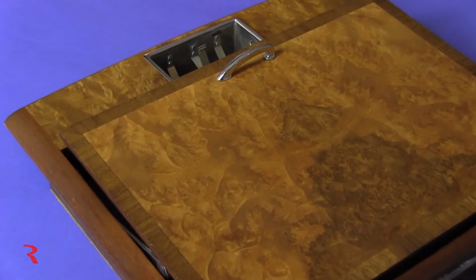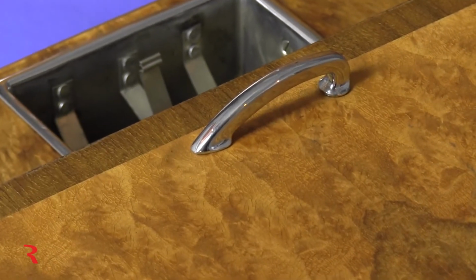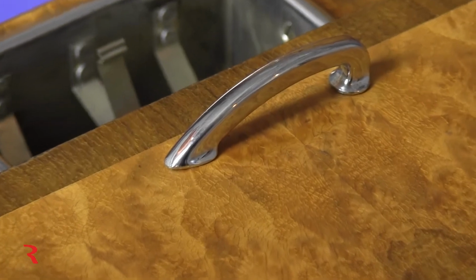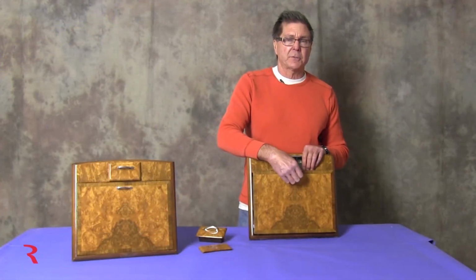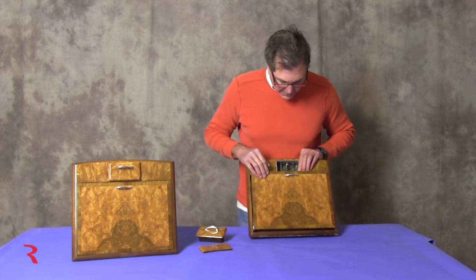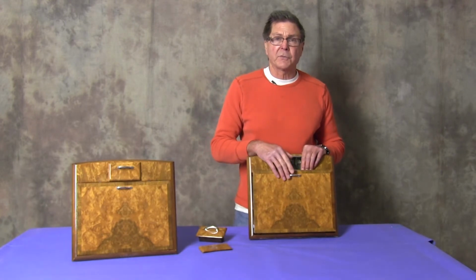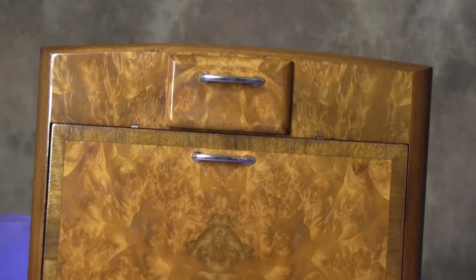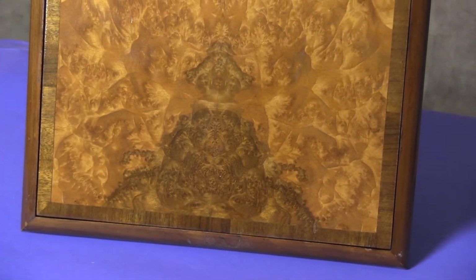So what you have at this handle is a stud and threaded interior thread, and then a screw that holds a dowel on, and that is glued in here as a permanent solution. So there isn't a good way of extracting it without damage to the table. So we will make an attempt to remove and use the originals, but after refinishing, you might want to put new ones on, and we have new ones for that purpose. So this is what a factory quintessential picnic table of the Cloud era looks like.